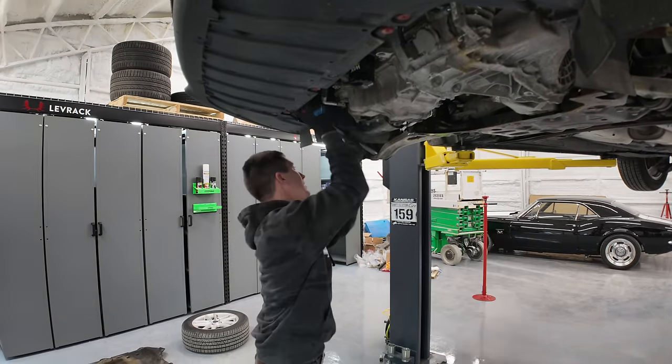All this stuff was working, but hey, it's going to work a lot better when one of the clutches engages properly. And one other thing, before I pull the clips out of here, I'm going to drop the clutch actuator back in place just to hold everything. We're not going to put the bolts in it, but we're going to drop them in place just to make sure that nothing gets out of whack. And then you pull off these shipping clips, you just release them like that and pull straight out, and then drop the clutch on. So that's all that's left.